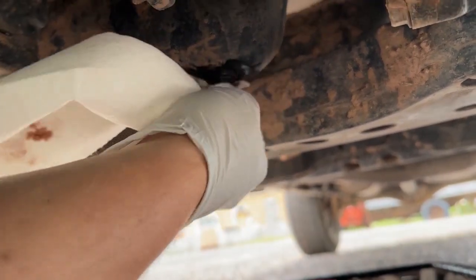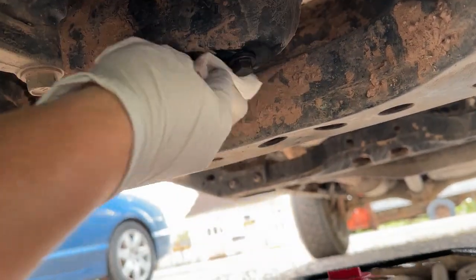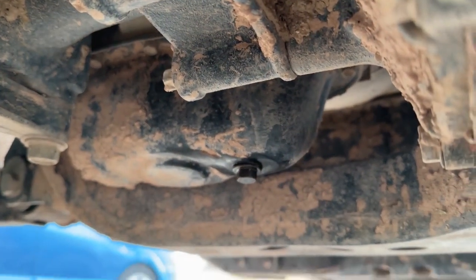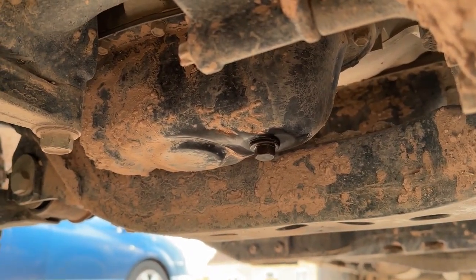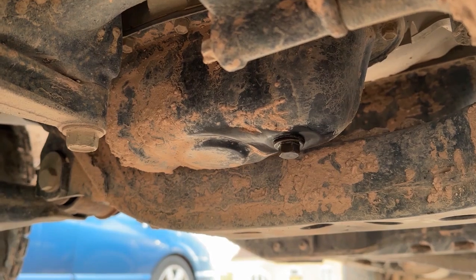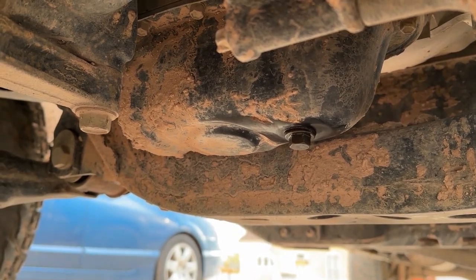Alrighty, like I said, once that's all drained, you go ahead and put your drain plug back in. That's why it's always good to have some paper towels so you can wipe this clean. You can also spray some brake clean on there. Get it really nice and clean so no dirt and gunk stick to it. Once you got that nice and clean, we're going to tighten her down. Honestly, I like to go hand tight. It has a gasket on there for a reason. You don't have to grab your impact or ugga-dugga machine and go crazy with it. Just hand tight. That way next time you do it, it's not stuck on there and you don't strip any bolts. So let's jump into the engine compartment again, fill her up, and we're almost done.